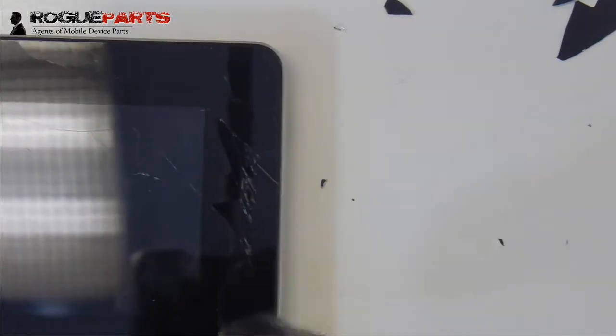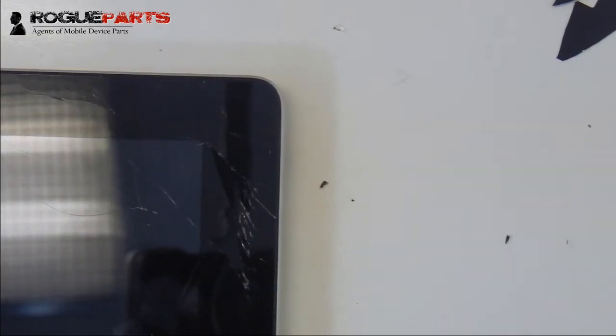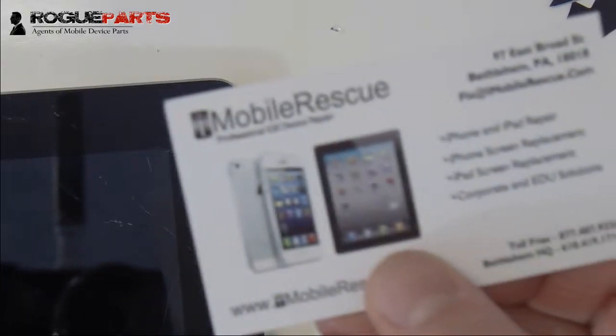So again, we're at 1050 Fahrenheit with the heat, and we're just going to blast this thing, maintaining again the idea that we're not going to keep it over the device for any appreciable amount of time. We do not want to burn anything. We don't want to melt anything. We don't want to fuss with the LCD's functionality via too much heat, because that can happen. And we would want to get it in that sweet spot so we can take our tool, whatever tool we're using, and square it away.